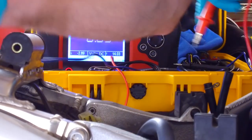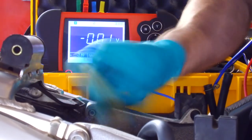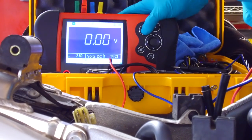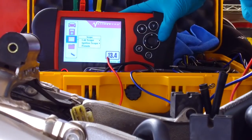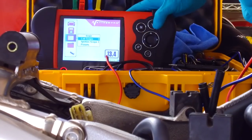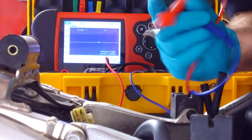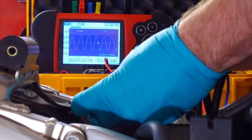Right, so first things first, let's do a voltage test from the generator. So the generator isn't plugged into the reg rec anymore. I'm sure I haven't got the headlights on, or flatten the battery, because we're just running off battery now, obviously it's not charging. We want to go find the smelloscope. That one. Hard to do it upside down. Right. We need a pokey pokey. So this is the AC voltage with it idling on the white wires. So that's the first pair.